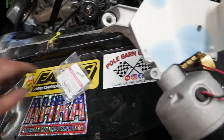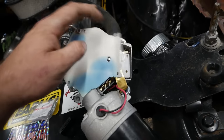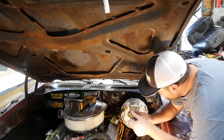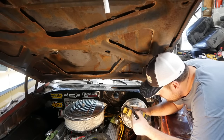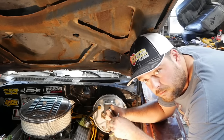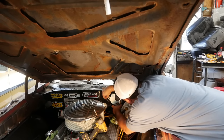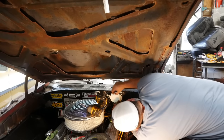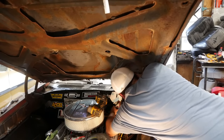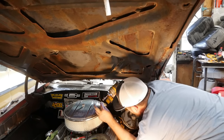Here's my wiper motor and a brand new wiper arm assembly. I don't have a cover for this because I don't have the wiper motor housing, so we'll throw it on there for now and get one on order. I don't have any of the hardware to attach this wiper motor to the firewall — they are a kind of unique bolt. So we're going to shoot self-tappers into it. I'm busting out my industrial-grade self-tappers for this job. You ever seen anybody self-tapper screw a wiper motor to their firewall? Probably not. And yeah — that's not going anywhere for at least a short while.